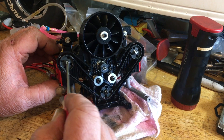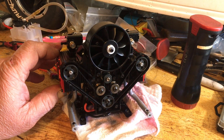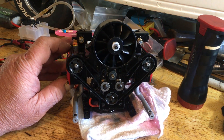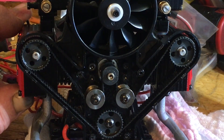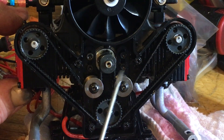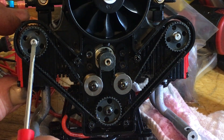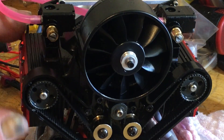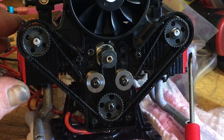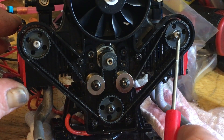This is your crankshaft and these are your camshafts. I'm going to zoom in so you guys get a really good look. You're going to see a little timing mark here and two dots on your camshafts up here. According to the website, the plain engine mark goes to the right, and the two dots on the camshafts go straight up.